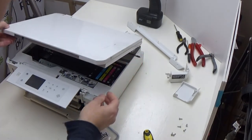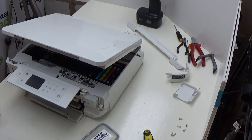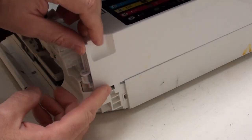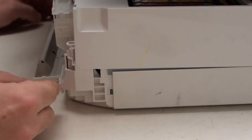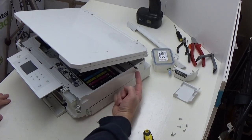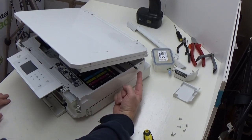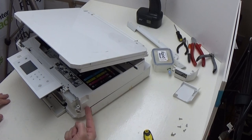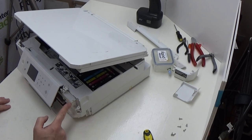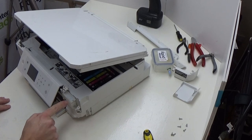Right, so what we're doing now is we are looking for our waste tube. The tube will run from the back down here, all the way from a little peristaltic pump — like a blood pump — all the way along the side here, where it goes around and up and then down around about here somewhere behind this piece of plastic, where it then has a little connection point above the waste pad holder.